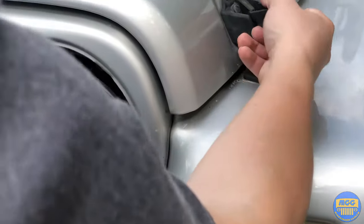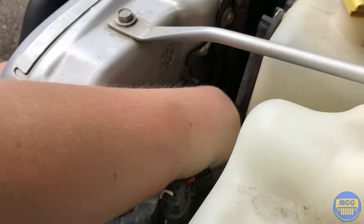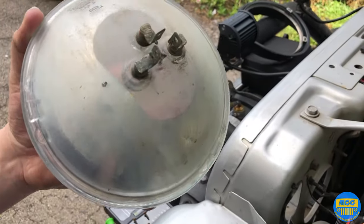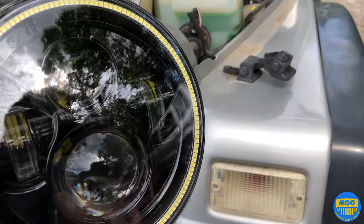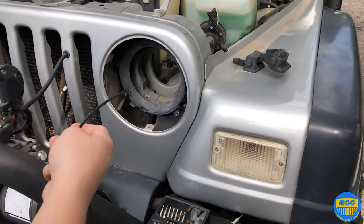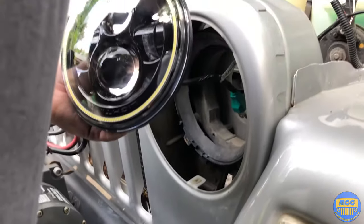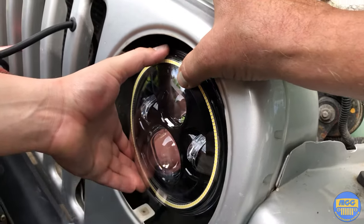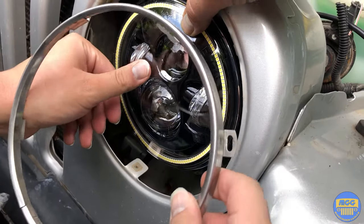You may want to pop the hood. Right back here we can just unplug — it just pulls right out, just wiggle it a little bit and the headlight comes right out. With the OEM headlight out, let's get the new halo headlight installed. We're just going to take these wires and run them right through here.